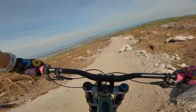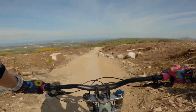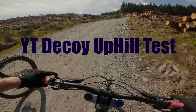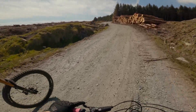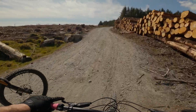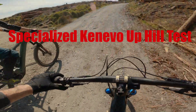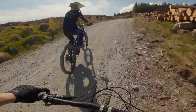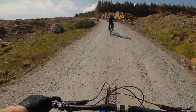Let's talk about the heart of an e-bike: the battery and motor. I think this is where the Decoy loses out to the Specialized. In our test, I was able to keep up with the Kenevo on a steep hill when I rode the Decoy, but I left the Decoy eating dust when I rode the Specialized. We rode in the same gear and spun at the same cadence, though I'm just over 50 kilos and the other rider is about 80 kilos, and weight makes a big difference. This is also down to the 90 Newton meters of torque in the Specialized Brose motor compared to 70 Newton meters from the Shimano E8000 — don't get me wrong, the E8000 is a really good motor with a proven track record.